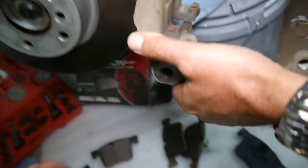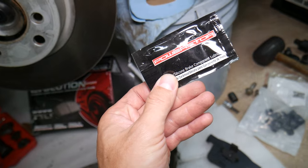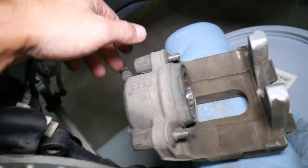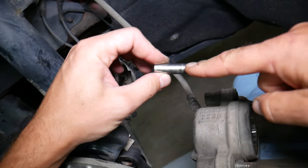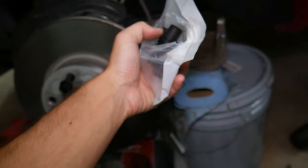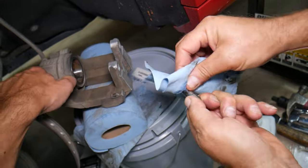We're going to get the new brake pads. This is the grease we have — we'll put a link where you can get really good brake grease at a good price with quick shipping. We recommend the ceramic silicone type — amazing stuff. We're going to remove the guides here. It's recommended to replace them every time you install brakes, though for some cars you can reuse them if they're in good condition — always check for that. If your kit comes with new guide seals, you can replace those as well. We're going to clean ours, but replacement is recommended. Remember: every time.